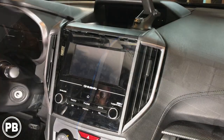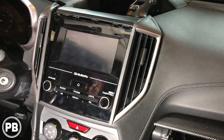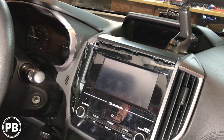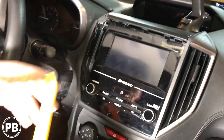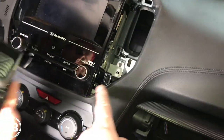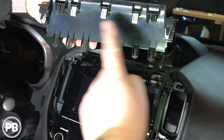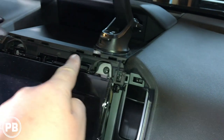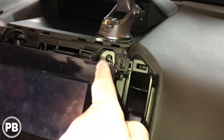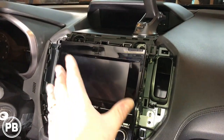We're ready to pop the radio out to access the speaker wire outputs from the radio in order to install a line-out converter for the amp. You'll have four clips on each side of the trim panel — use a panel tool or your fingers to get underneath those corners and pop them out. The top piece is the most difficult, with three main clips in the middle, two on the outside, and guide clips that guide into the upper panel. The upper panel doesn't need to come out but may come loose while prying. Once all those are out, you'll have four Phillips screws holding the radio in — pull those and the radio will come free.